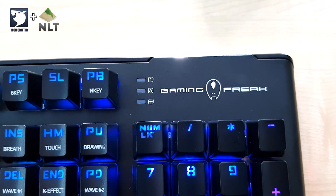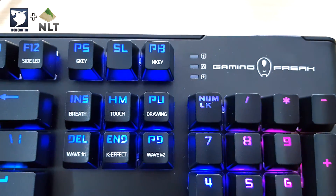Something to note is the 6-key and NKRO modes. Some of you might find 6-key pointless when you can have NKRO, but this is because certain operating systems cannot recognize the device due to NKRO — you'd have to switch to 6-key. For NKRO, most keyboards use device emulation, meaning when you plug it in and look in Device Manager you may see two or more keyboards listed — that's how they achieve NKRO.